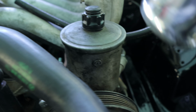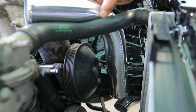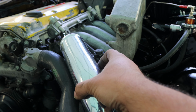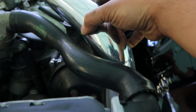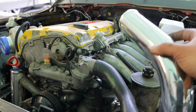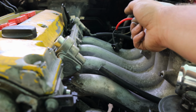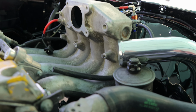to go up like that. To go up from the intercooler, come around and fit in that perfect spot here, where it's gonna give you enough space to open up the reservoir for the power steering. It's not gonna touch the pulley, but it also goes into that recess where the stock pipe has, and then from here the plan is to go into a 45 and then to a pipe cut 90 that will go directly to the throttle body, and this should be quite nice.